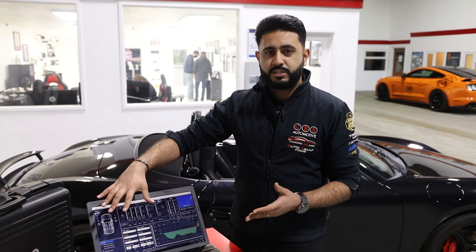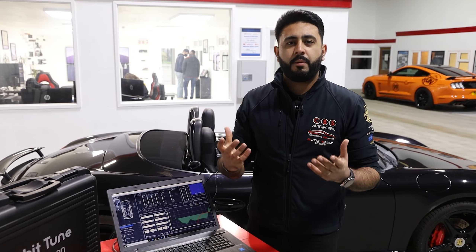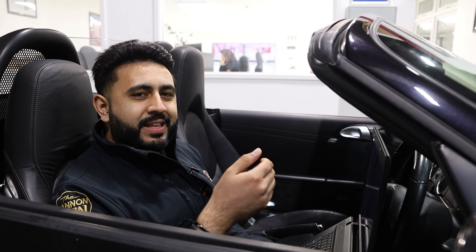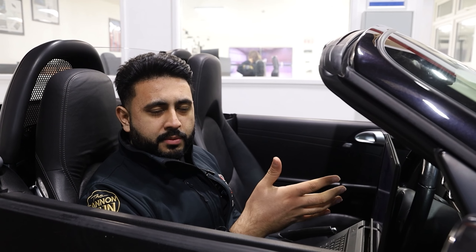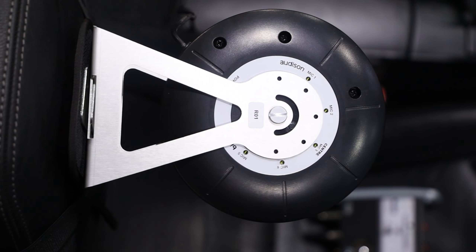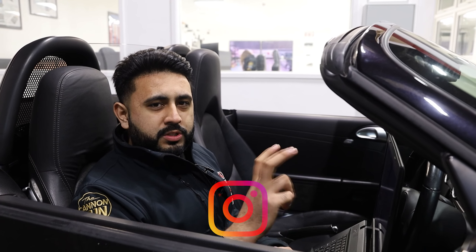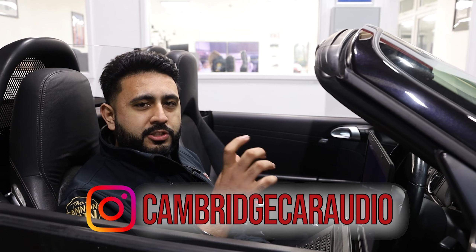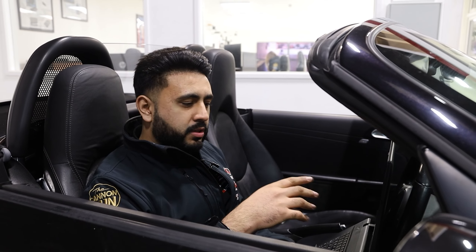Now that the basic correction is done via the BitTune software, it's time to jump inside the vehicle, put on some of our customer's songs, and actually tune it by ear — fine-tuning everything to get it sounding awesome. With the car being a convertible, we've also got to take into account road noise when the roof is down, and effectively two different setups — roof on and roof down. What we did with the BitTune software is analyse the system with the roof both down and up, and work out the best possible solution. If we did want two different setups, the processor does allow that — we can add a controller to the system that allows two or more presets depending on the processor being used.